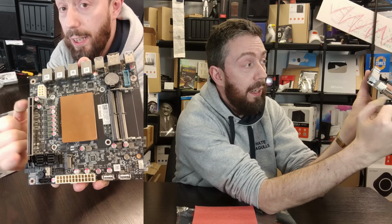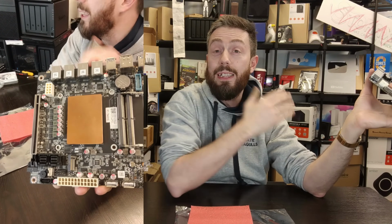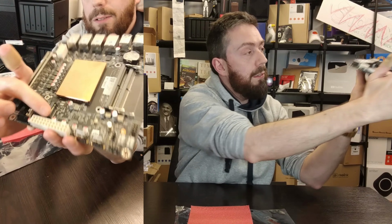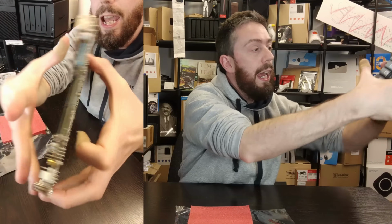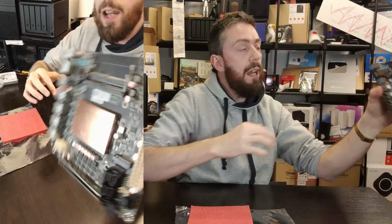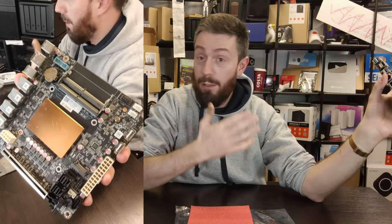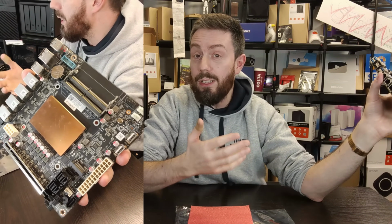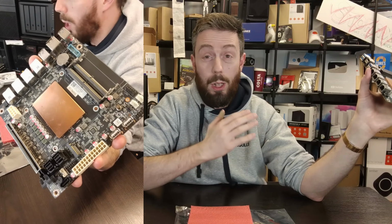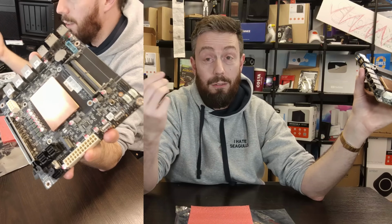Now, you might be thinking, oh great, I can put a SATA SSD inside this. That might be the dullest thing I've ever heard, because thanks to this being Gen 4 architecture, both the top-mounted M.2 NVMe connector and the base M.2 NVMe connector are Gen 4. Which means we're looking at some lovely speeds, at 2,000 megabytes per second potentially through every lane. They are Gen 4 times 2. However, whether that is for heat or just because they've had to stretch it out so far, we'll have to see.